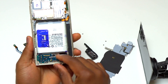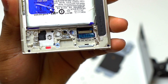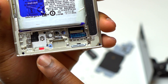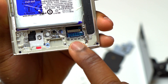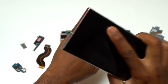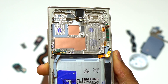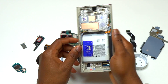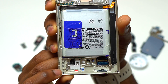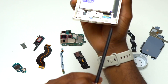Where we have the SIM card tray and the SIM reading tool, the first thing I saw after removing the charging module is the red dot. This red dot means that water has passed beyond the point of the SIM card tray. The SIM card tray is also designed to hold water on that area, and this device is officially water damaged. When I first got this device, I did a water resistance test and the device survived 30 minutes underwater, and right after that I did a teardown — that is a great complementary video to this one.